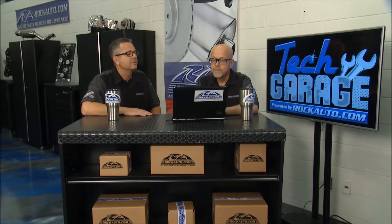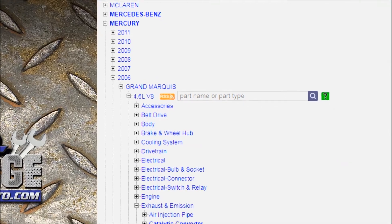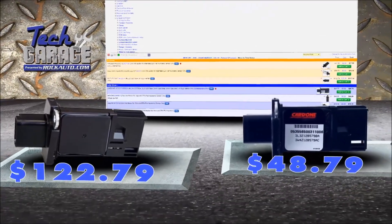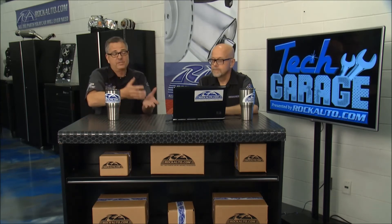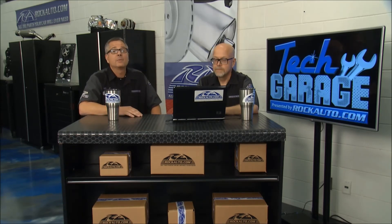Now, what about the mass airflow sensor? I know there's a lot of problems on that car — I bet there's a heart there. Especially in Florida, we got love bugs flying in them, and there's a heated element causing false readings and all kinds of things. We're cleaning them continuously, and they cause big problems on these cars, especially when it comes to running. So let's just take a look. Mass airflow sensor — sure enough, yes, it's bold print. Bingo! We have lots of manufacturers — Motorcraft and Cardone are hearted. A lot of people are buying that particular part number. Definitely another way to get clues about how to diagnose your vehicle based on what other people are buying for it. This is a good way to diagnose your vehicle — if you have a bunch of problems that are failing and everybody's buying them and your diagnostic leads you in that direction, it's probably what's wrong with your car. Stick around — we got plenty more Tech Garage when we return.